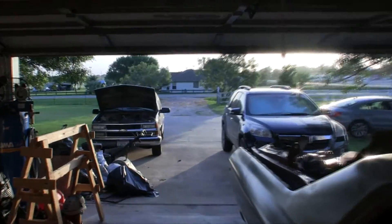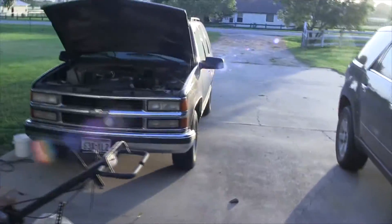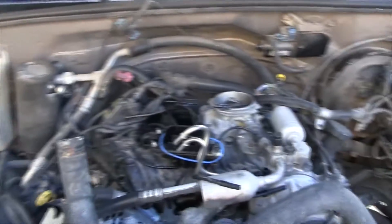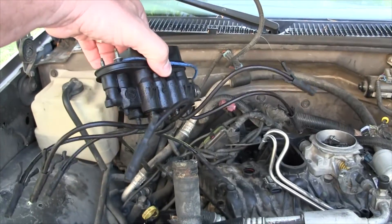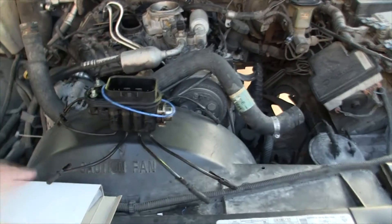Back on the Tahoe — I mentioned in previous videos that I was having trouble with one of the cylinders dropping. I took the spider injector — the fuel injection assembly, the central port injector — apart, and I was having trouble with cylinder number 7.